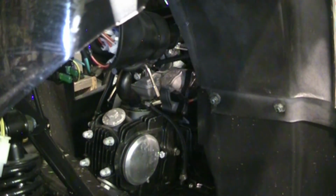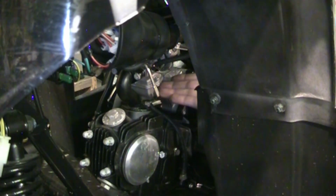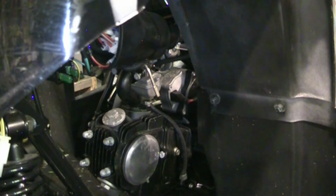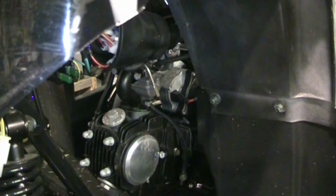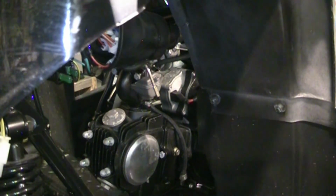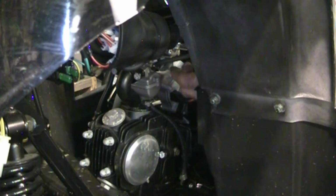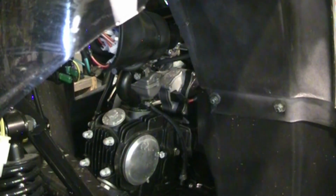I say we give it a shot. Turn fuel back on. So you're going to give it a minute, make sure that the bowl is going to fill all the way to the top and not come out the overflow. I don't want it to come out of that overflow tube now. That would tell me I'd have a float or a needle and seat problem. I got the garage door all shut, but I can hear through the wall that somebody's got a little two-stroke something running, revving up, and not sure what it is. I'm not seeing fuel out of the overflow, so let's give her some choke. Oh, I've got to turn my battery booster thing back on.